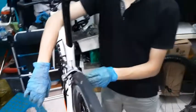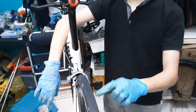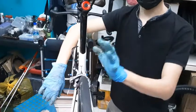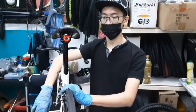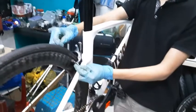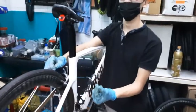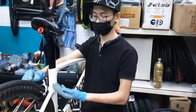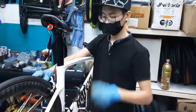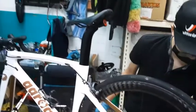You adjust the brake pads when you are swapping between wheels, because each wheel will have a different height and different brake track placement. Also, when changing from carbon to alloy wheels, you have to change the brake pads. There's a small screw here — undo it and you can slide the brake pad out, then slide the alloy one in and tighten it. It's that simple: slide it out, slide the alloy one in, tighten it.